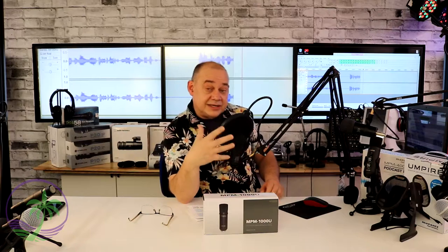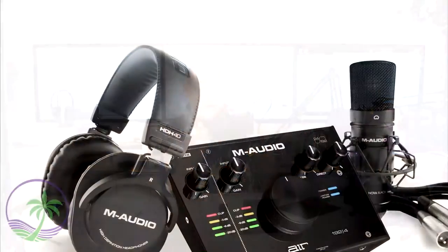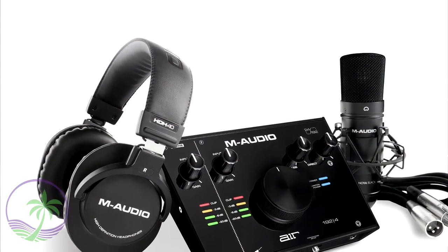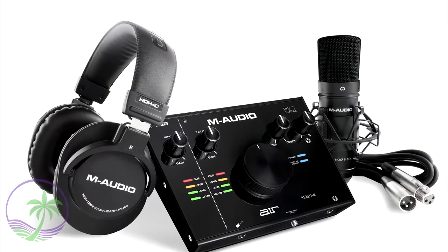It's important to note that with a built-in USB, the audio interface — the digital portion — is built into the microphone. You have to ask yourself: is this the only mic I'm going to need? If you're thinking you need three or four mics, you're not going to buy three or four of these. This is one per computer — you can only use one audio interface at a time. If you are thinking about getting three or four microphones, you might want to look at an audio interface. There are lots of them from M-Audio, for example, in a reasonable price range that do an amazing job.